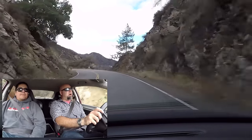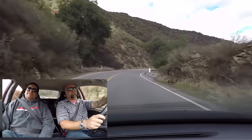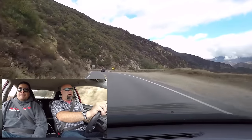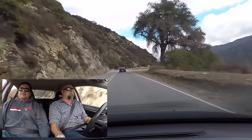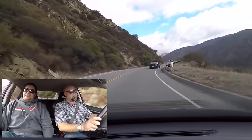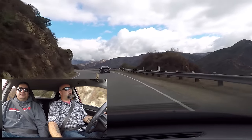Ignoring the upfront cost, let's talk about a 300 horsepower engine. Is there any real downside to an engine like this? Is this just slightly higher maintenance? That's it. You just have to keep an eye on things like the tensioner. That tends to fail more often on high lift cam motors.